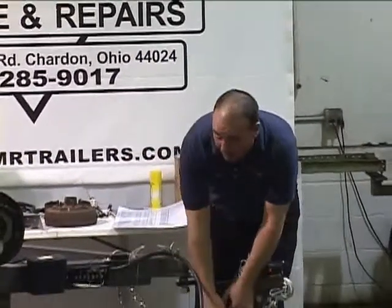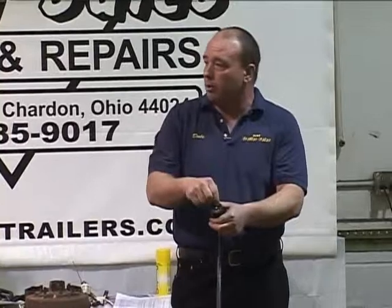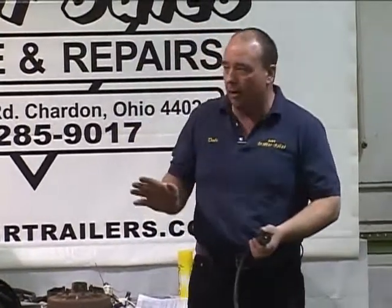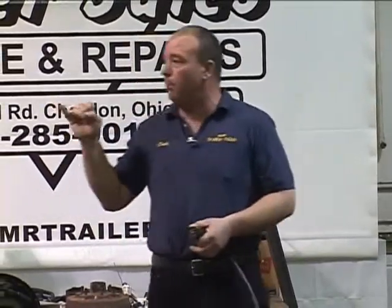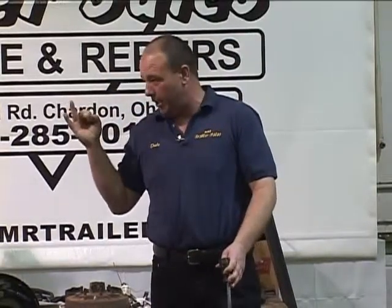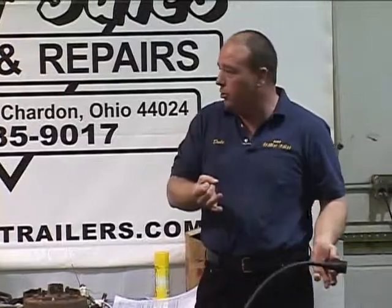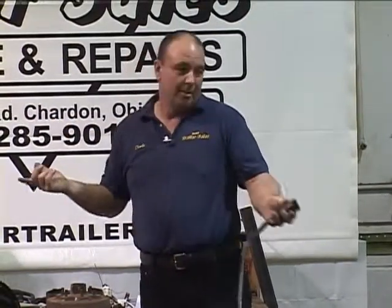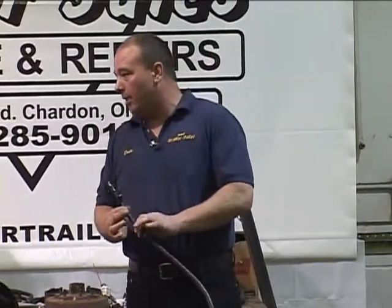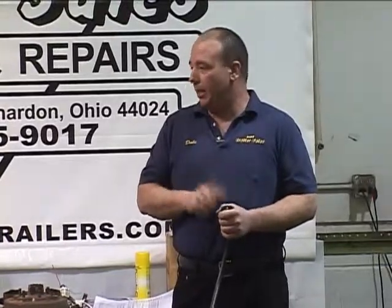Most trucks will have your seven-wire plug connector built right on the truck — it's all wired and ready to go. Some older trailers use a six-wire plug, still round but with round holes. If you have a seven-wire plug on your truck, don't cut your wiring — there are adapters. On the six-wire, you have a center pin that is either a hot lead or a brake lead. Easy way to find out if you have the right adapter: go to a dealership or AutoZone with your trailer, plug it in, put it in gear. If it doesn't roll, you need the other adapter. I recommend the seven-wire over the six — the terminals don't tend to corrode out and you get a better connection.